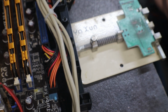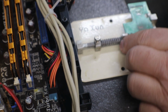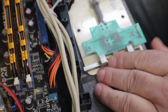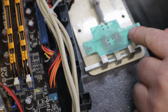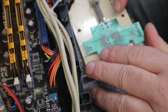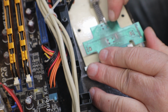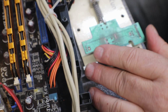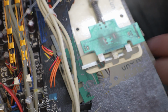Alright, so you see what I'm doing. I'm going to do the bottom switch the same way and isolate the power switch as well. That way I want to see if I can get more than 1.84 volts to our LEDs. So I'll bring you back once I get this. I'll probably just go ahead and cut, not even worry about cutting that little itty bitty trace there. It's no big deal. We can solder to the leg. Okay.